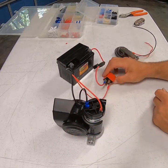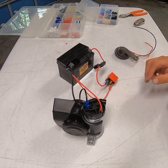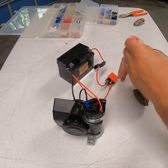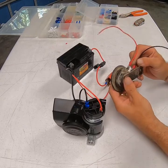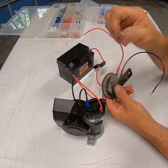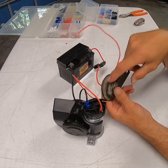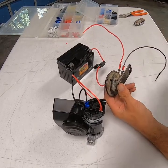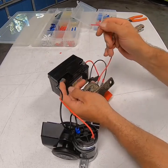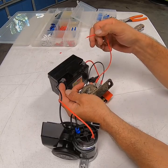The thing that some people get confused about is how the horn works. The horn basically works off a positive and a negative connection — you've got 12 volts in and a ground. This works kind of like a doorbell. When you push the button on your horn, you close these two circuits and send 12 volts into the horn which makes the noise. Essentially, this is grounded all the time, and when you send power down the horn, you get a beep beep sound.